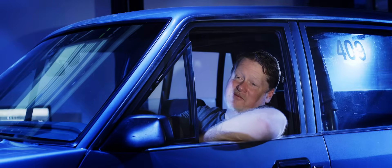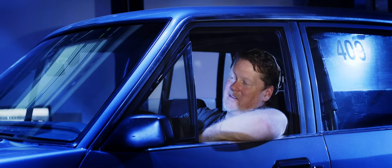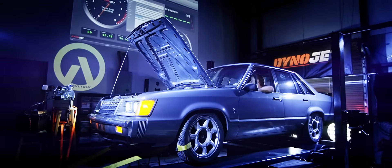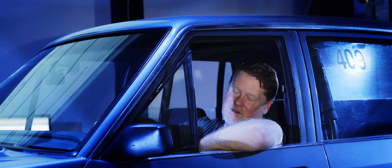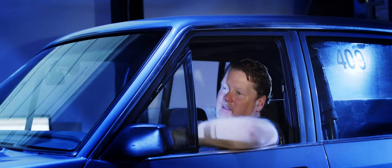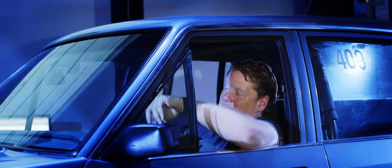One thing we haven't told people is that I'm messing with the PCV system and I have it disconnected, which is why there's all kinds of oil smoke that you normally don't see. What's it say? 313. We're down — down 26 horsepower. Torque's at 309. Let's take a look at the data logs and see what kind of tweaks, and let's reconnect the PCV system. It's like a refinery in here.